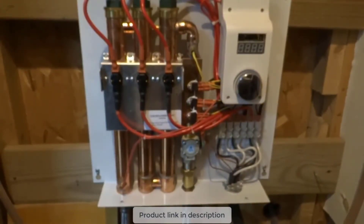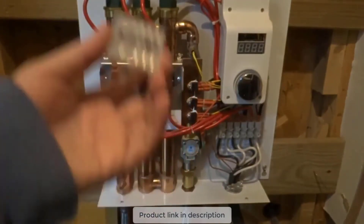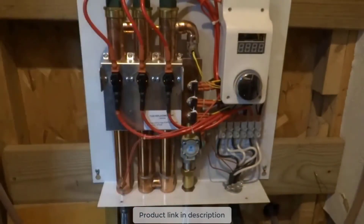The fuse was blown. I had to reorder replacement fuses — it required a particular fast-acting fuse. I'll link the part number in the YouTube notes below. This was for the ECO 27 kilowatt model, so it might be different for other sizes, but they're available right on Amazon. Popped in a new fuse and it instantly came right up — no other work needed, just a fuse replacement.